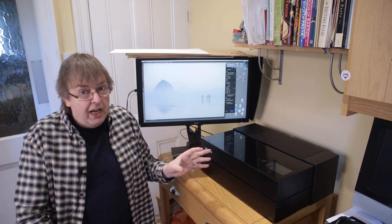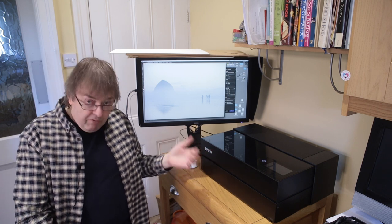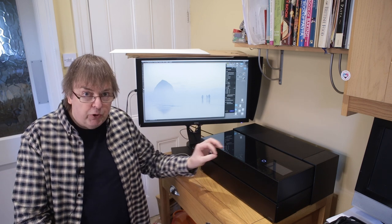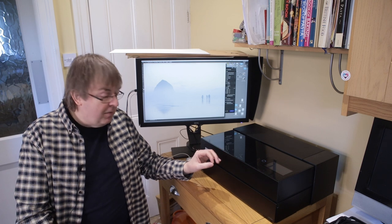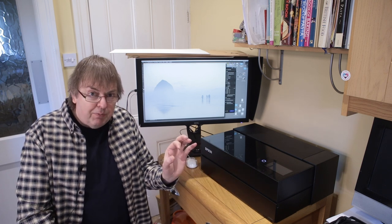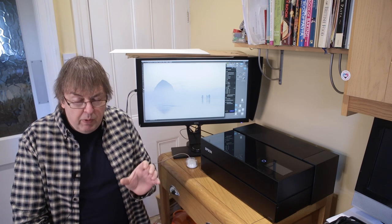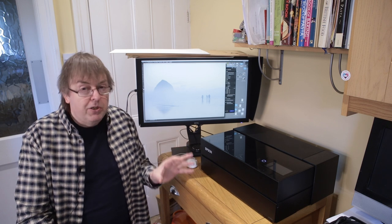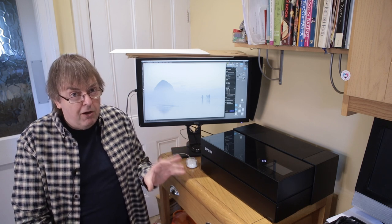I've also looked at using photo papers where you want to get rid of potential marks on the surface of the material. So there's a way of feeding paper in here. You have to have large margins, but if you get the dreaded pizza wheel effect on glossier papers, then you can use the front feed. But this is just using the front feed for an art paper.